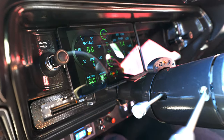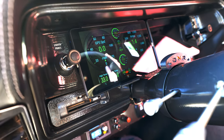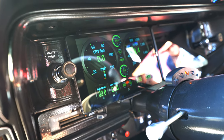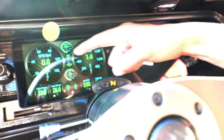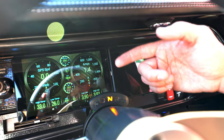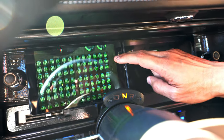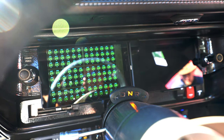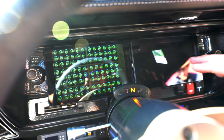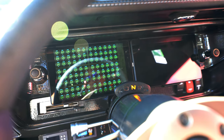What we're looking at here is the Torque Pro app — a very popular app anybody can download for their car. In my case all this data is from the battery management system: GPS speed, amps being drawn, pack voltage, state of charge, high and low temps, high and low voltages. We can go even deeper and look at every one of the 96 cells on a single page, so if something is straining more than it should, I can pinpoint which module it is and swap it out or service it.